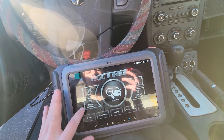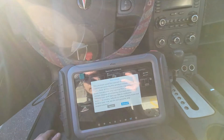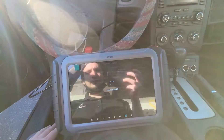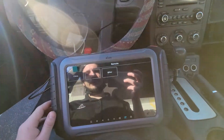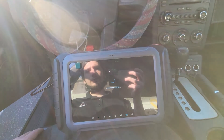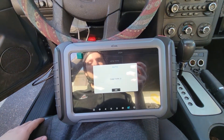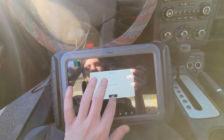...we're going to go to Special Functions, Immobilization. From there we're going to go to GM USA, and then Remote USA. We're going to select auto ignitions on. By the way, make sure you have the key in the ignition in the on position, so it auto detects as a CAN type 3.